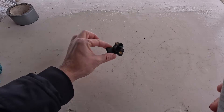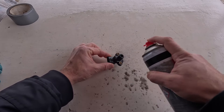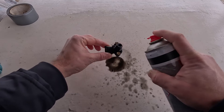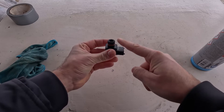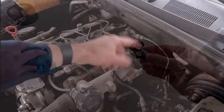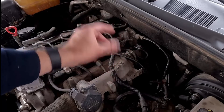Also, while you're at it, if the sensor looks dirty and covered with soot, you can try to clean it, as this helps in many situations. Simply remove it from the engine bay and put it on a workbench, take a can of brake cleaner, and spray it all over the build-ups. It may take several tries until all the gunk is removed. Let the MAP sensor dry for a few minutes, then refit it to your car and redo the tests to see if this made any difference.